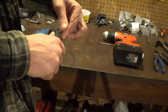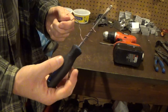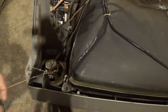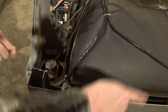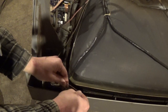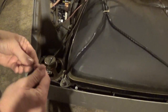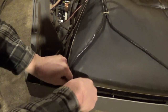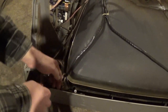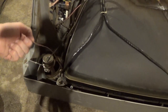All we're going to do is take the copper wire and wrap it right around our screwdriver just so that it has a good connection. Then we're going to take this end and ground it out to this metal bar here. You can see there's a little hinge here — this goes on the metal bar and that's the ground for the TV. We'll just feed that through and twist it around a little bit just so there's a solid connection there.